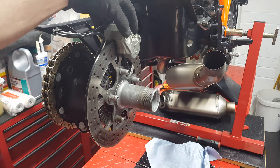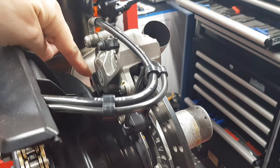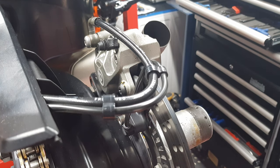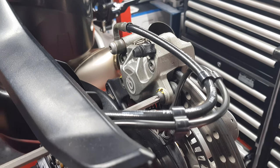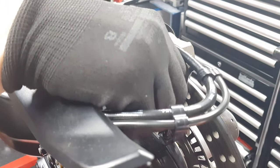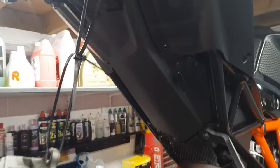The next stage is to take the brake caliper off and the speed sensor. Just undo the two T40 bolts for the caliper — I've got a six mil stainless steel bolt in there rather than the standard 10mm. Take the speed sensor off and get that out of the way. It does help having the long-reach bits. Right, that's the brake caliper off — just hang it around the bracket so it's suspended out of the way.